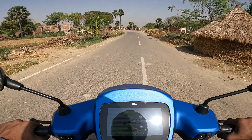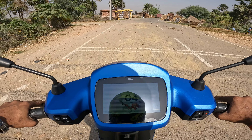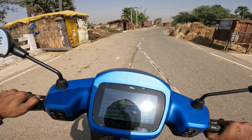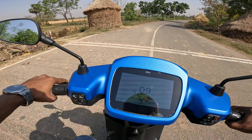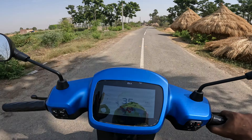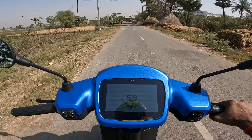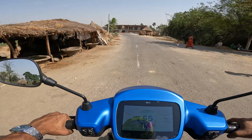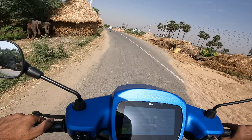This is top-notch performance. There are many speed breakers here — the feedback through them is good but the suspension still has flaws. The power quality is much better than the first generation. It feels like the motor spec is 11 kW with a 4 kWh battery and a claimed range of 195 km — in real world expect around 140–145 km overall. The leaning angle is very good, which is a big improvement.